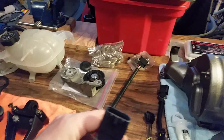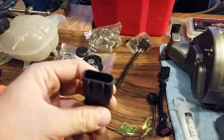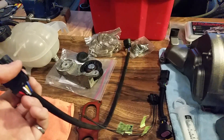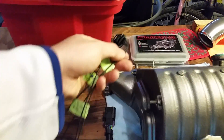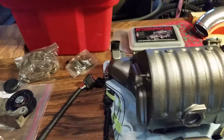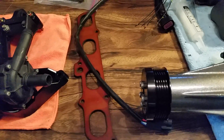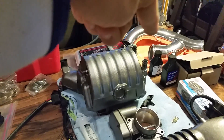The MAF extension is literally just a wire extension. When I have my harness here for the T-map sensor, I'm probably just going to split it directly into the MAF extension to override that temperature reading. So the computer will be reading intake air temperature from the intake manifold over there, not from the MAF tube.